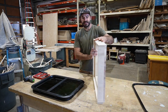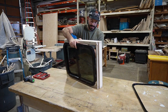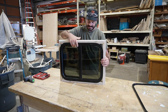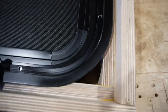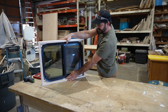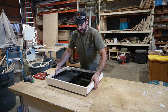So let's say this is our box here — this is the outside of the bus. I will be inside the bus holding this and we'll set it into place just like that. Imagine the bus skin, so you wouldn't necessarily see all of this. On the inside, we'll take our trim ring — it goes right in there, pinches the window — and that's what we get on the inside, with our window sitting out there on the outside of the bus. I hope that makes sense. If it doesn't, you're going to see us do it, and that will clear things up for you.